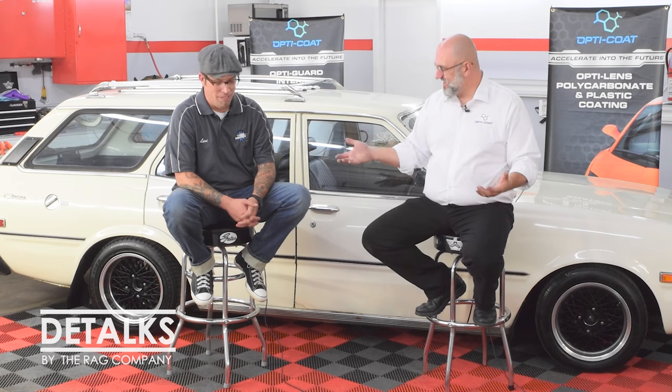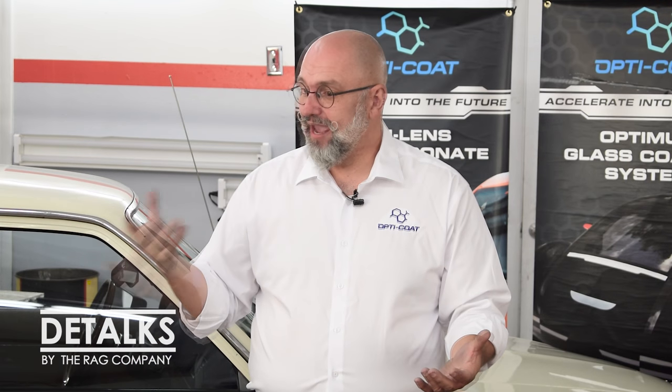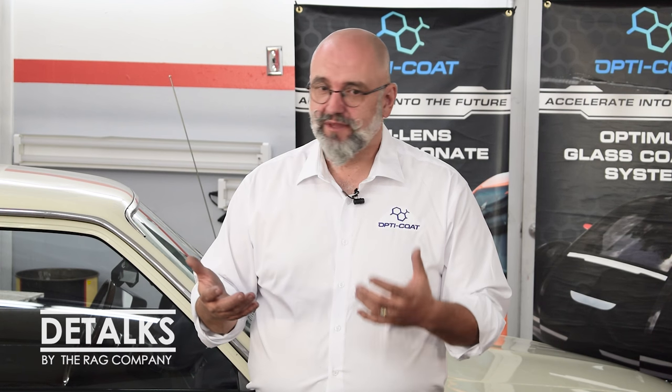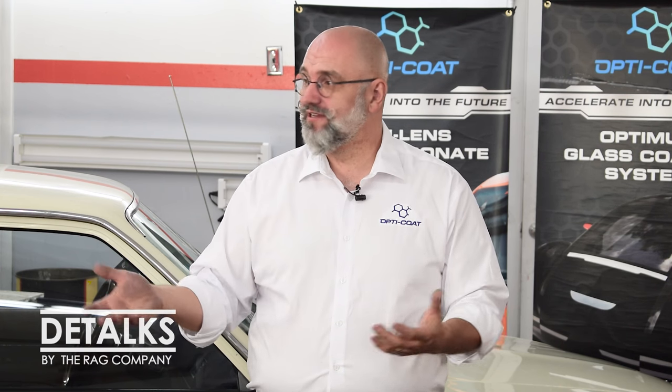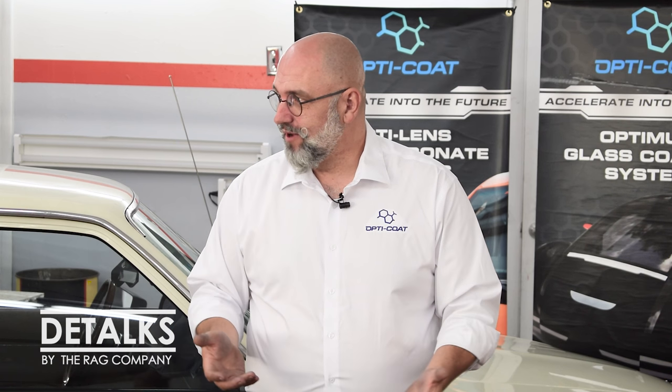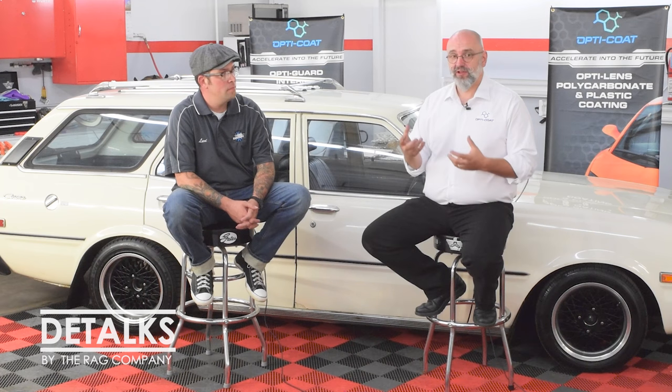For heavy correction, it can be done with the DA. There are people that correct paint with a short stroke DA, like a Porter Cable. Sure, it can be done, but it's a long, slow process. A rotary is just faster and actually less aggressive. People think a rotary will burn paint. Well, it used to be that we'd use the rotary at 1600 or 2000 or 2500 RPM, and you'd burn paint that way. And wool pads, people are afraid of the wool pad. But the wool pad actually runs cooler than a foam pad, because you have a lot of air movement.